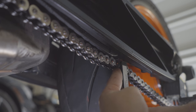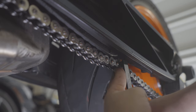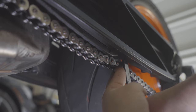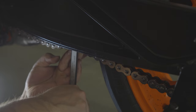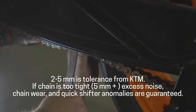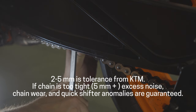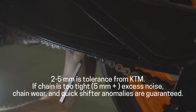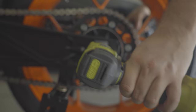This measurement is very convoluted — there are several other angles you can get. I'm showing another angle here that is obviously suboptimal, being that I had to put my face where that camera was. But after several measurements, what you'll find is hopefully a number in the realm of two to five millimeters. Two being a loose chain, five being a tight chain. I arrived upon 4.3 millimeters, meaning my chain has been pretty tight, and I've been experiencing some quick shift weirdness as has been relayed in my previous videos.